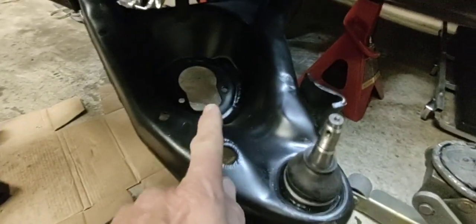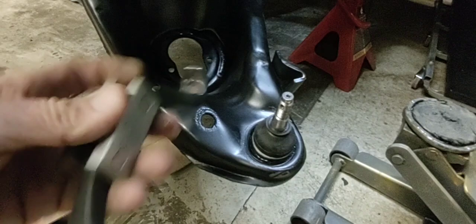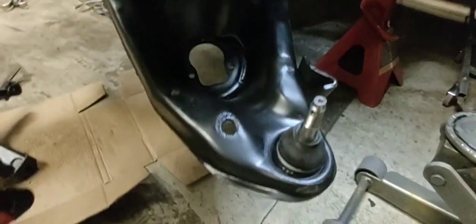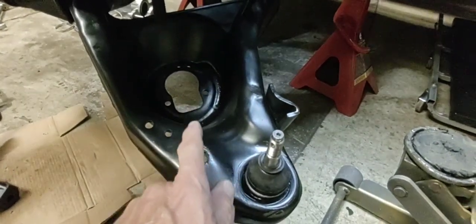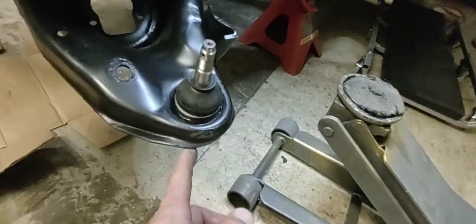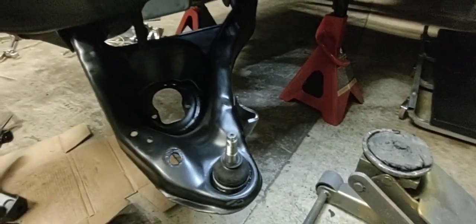And then I get my spring in there, push this control arm down, and then weasel this, how's it go, goes like this. Weasel that in there and then compress that spring. And then you can use a bar and start to get the thread in there. And then get the floor jack underneath it, give it a little bit of tension underneath the control arm, and tighten that spring compressor up a little more, and then jack it up a little more and bar that bottom of that spring in there.